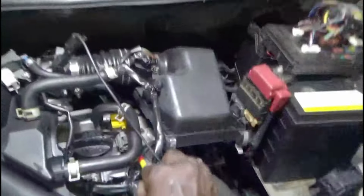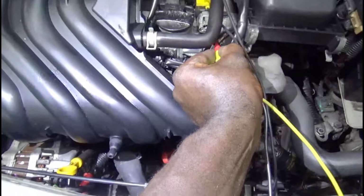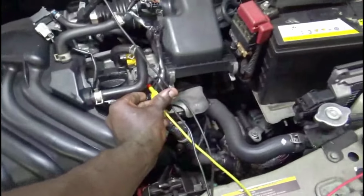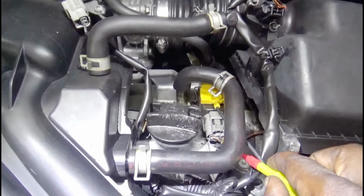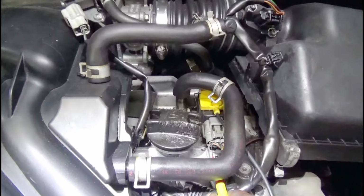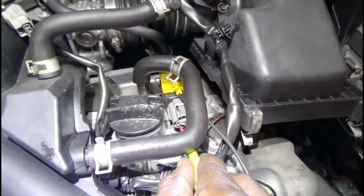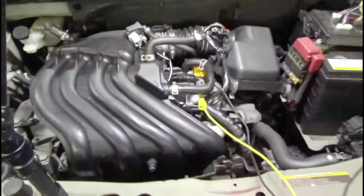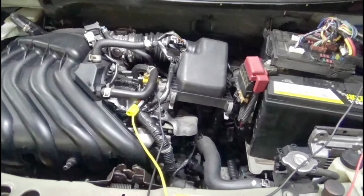Did I? So I'm not sure if it's my pin that is the problem. Yeah, so I had some pin issues. Right, so you see I'm getting 12 volts right on the power wire, which is a brown. The black is the ground, and this one has to be our trigger. Okay? So this trigger comes from the ECU. So let's see what's going on, right? Let's stop this, and we start.